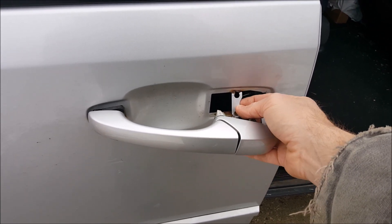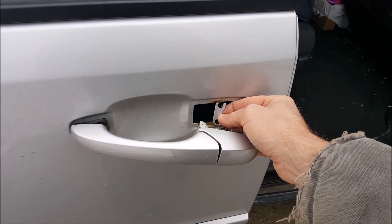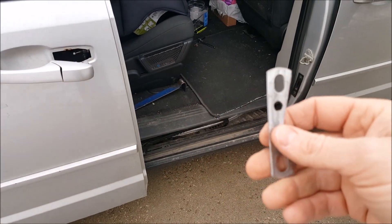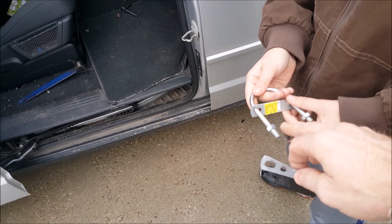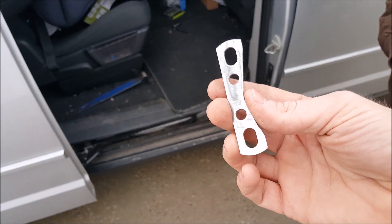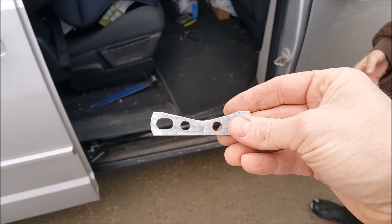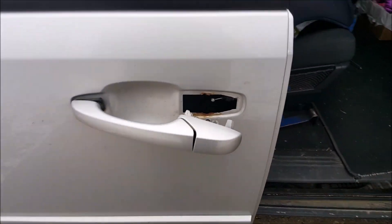This thing's been broken loose from one end for quite a while — I think the top broke loose quite a while ago. So we've got to fix this. What I did was make a part. I had a few of these u-bolts with a flat on them. I'm sure Home Depot has narrower ones. I matched up the holes, used a center punch, drilled a little bit larger, then scratched along the side and did a little grinding. It's not perfectly symmetrical, but it'll work.